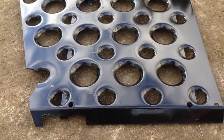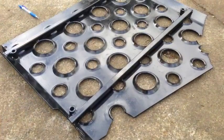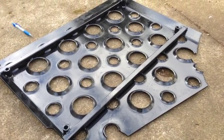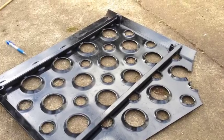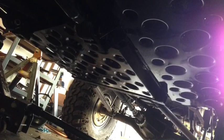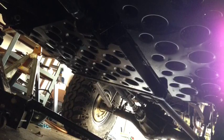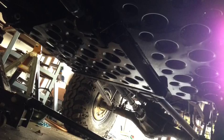In this situation I used three different plates to do the underbelly of the vehicle. This is the main skid plate — I also press-braked up the ends of that. Basically this is the underbelly of the vehicle, obviously protecting all the components, but also making a nice smooth surface that we can slide off of when you get onto big rocks.